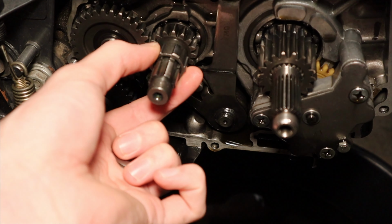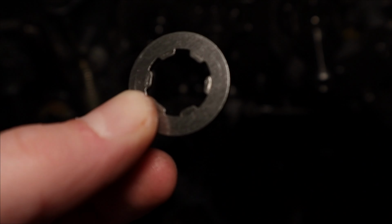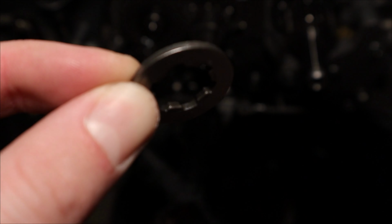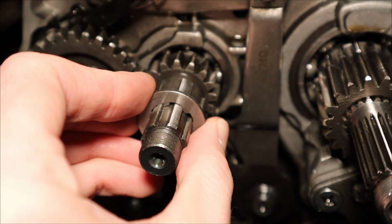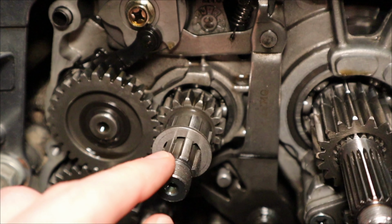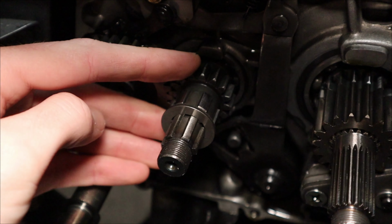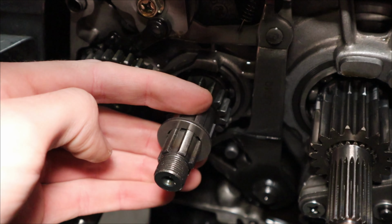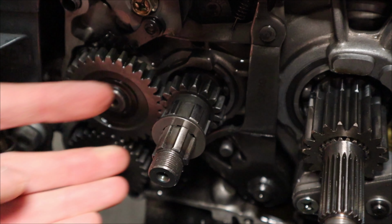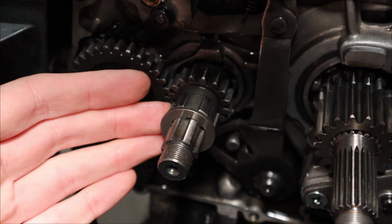And the reason why is because it's actually attached in the back where this notch is. So it uses a notched washer that you see here, and it attaches on the shaft, but you shift it, and then there's another locking washer with tangs that go in there to lock it in place. And if you can see here, there's still a lot of play that happens behind it, and this is where the basket actually holds on.